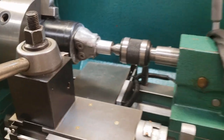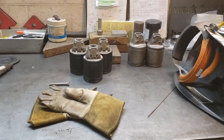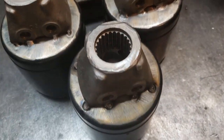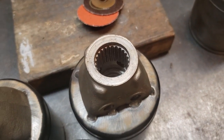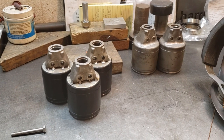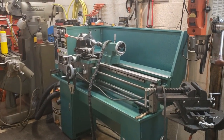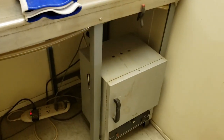You want to eliminate cold cracking — tack it well enough to keep alignment, then put it in the oven at about 375–400°F for around three hours and just let it sit. These ones have been tacked up, and you can see down in there the pocket and their alignment. They'll get welded to look like those finished ones, then everything gets sent out and reheat treated. Axles will soon be ready and we'll bring the frame in to start work there.